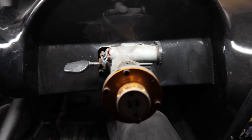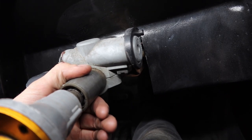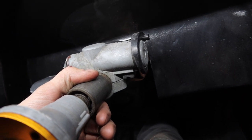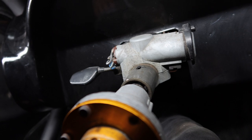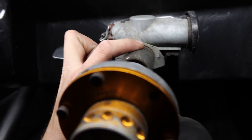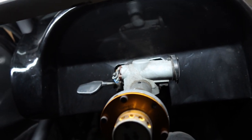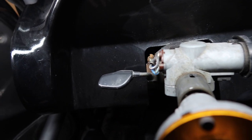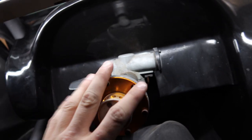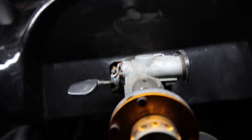I've got the stock column right here — I still have a stock column; sadly it just works so I'm not going to replace it. On the stock column there's a little circular part you can mount the dash to. Pretty much you just sandwich it onto the column and clamp it down and you have your dash mount wherever you want it. I measured it out beforehand to see how high it would sit, let Daniel know what I needed, put the steering wheel on, and measured the height I need the dash to be. Hopefully it fits good.